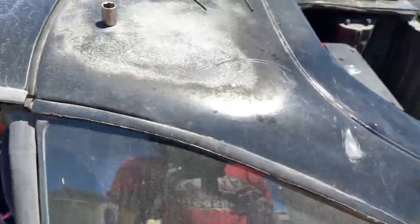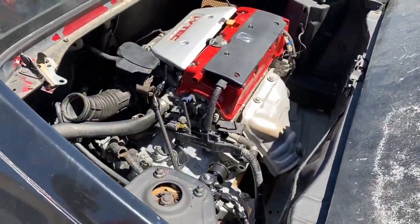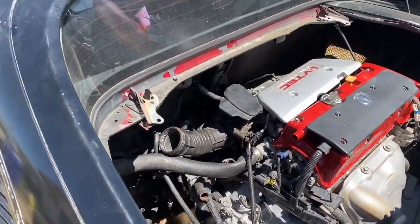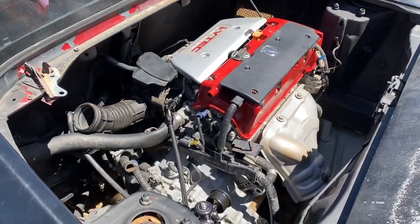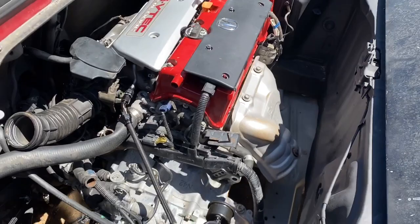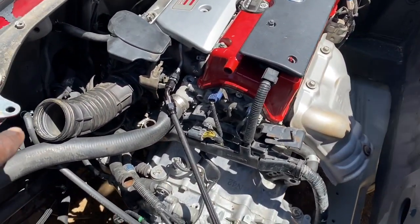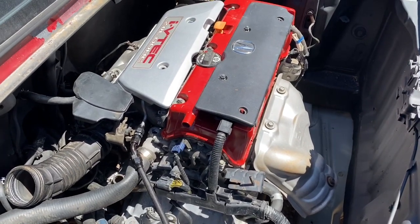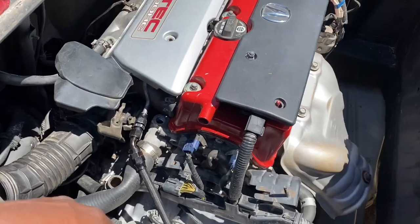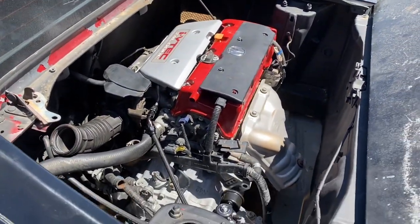So now that I know everything is running and starting, I can start cleaning up everything and wiring up everything, but that'll all be next video. I'll show you guys how to wire up the cluster for 05-06 wiring. We'll get all the radiator lines finished up and tightened up, bleed the clutch line, throttle cable, and then we'll get the thermostat, the radiator cap on here, and should be able to go for a test drive and see how it feels.